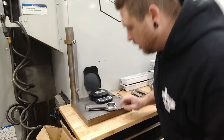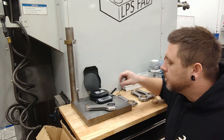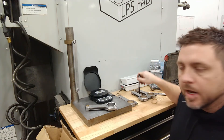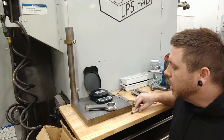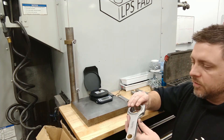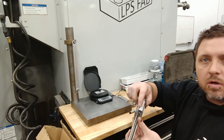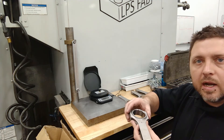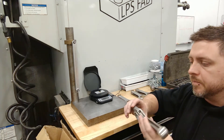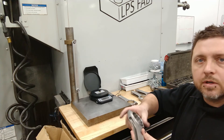I've actually got a rod here that's quite a bit heavier than the rest — by almost a full gram over the lightest rod on the big end. I can tell that one started out heavy because I've already done some grinding on it. So I'm going to take these corners to the belt sander and just try to take a little bit of weight off that end in equal amounts all the way around the rod. It's not going to take much, so be careful not to overdo it.